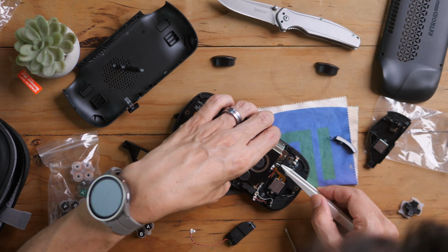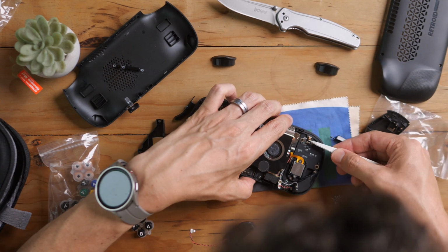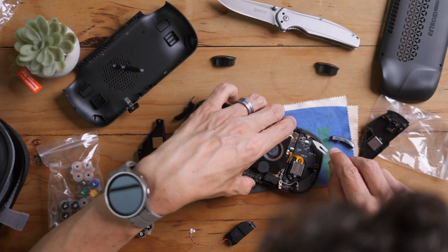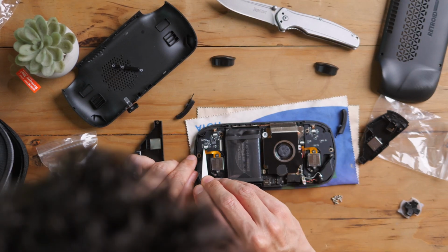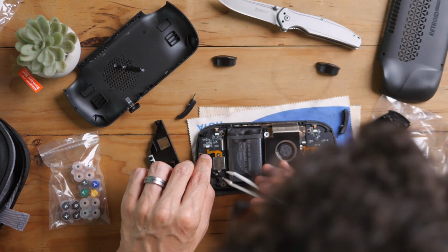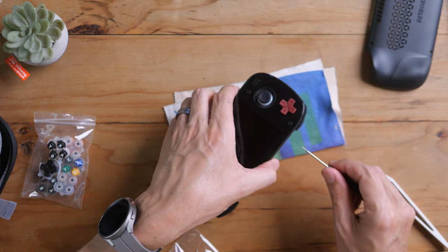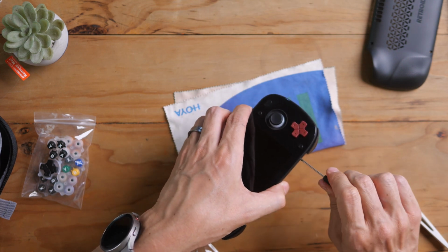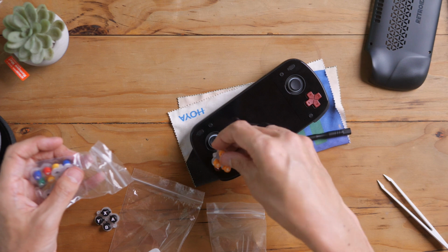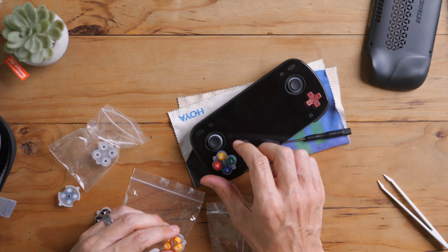And yeah, just go back the way you came and slowly but surely put the whole thing back together. Bit of a mission, bit disconcerting, but yeah, it's okay. And also we've got those little, I think they're called JST plugs. Make sure all those things are plugged in for the speaker and what have you. All right. So now those little screws, it's a plastic body, so don't over tighten these screws. Just gently, I usually do a little reverse screw and notches in and then screw those in.